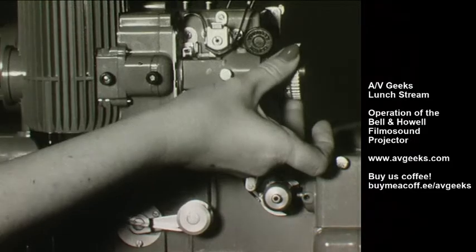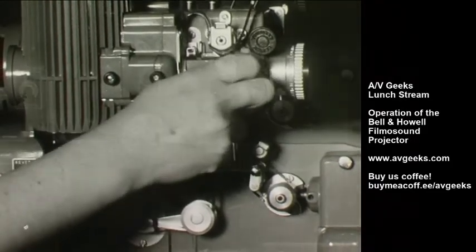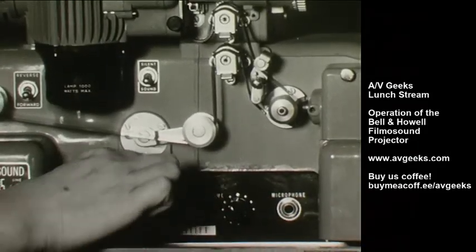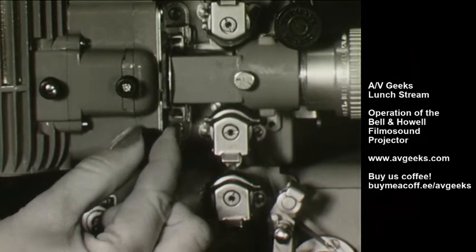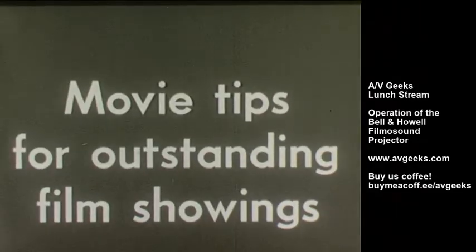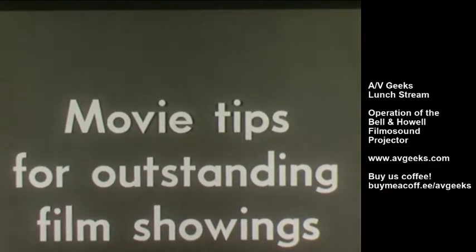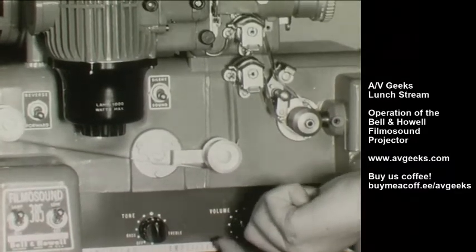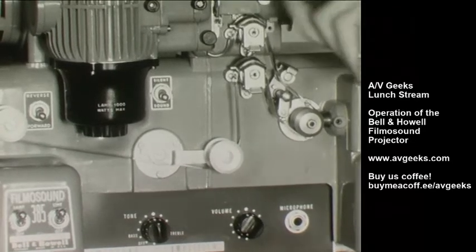Focus the picture by turning the lens. Then tighten the lens lock screw. Set the volume control and adjust the tone control. The framer knob can be adjusted to eliminate any frame lines that may appear. If the picture has advanced too far, you can reverse the motion of the projector. First, turn the volume control down. Stop the film by turning the clutch control counterclockwise.